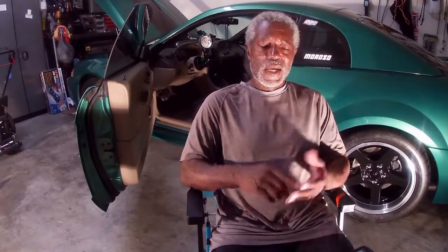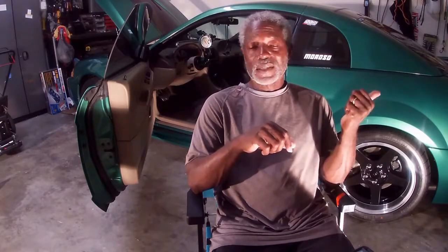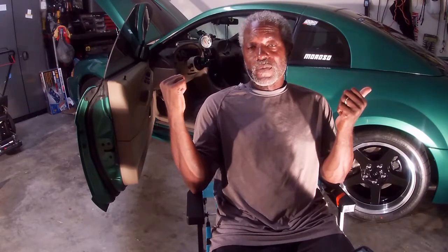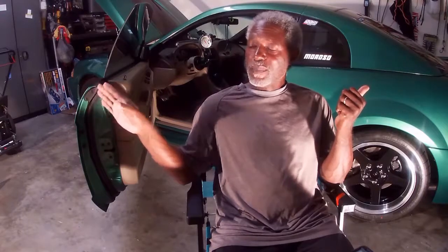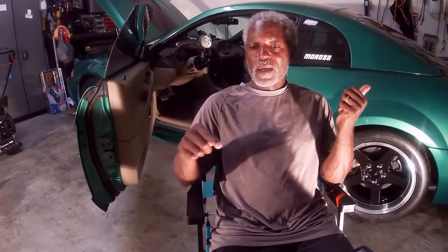And so you have to take loose the power steering hoses that are underneath there, anything that connects to the radiator. I had to take loose my positive battery cable because my battery is in the trunk, because I have a reservoir for my supercharger, which coolant goes in to keep the supercharger cool. So that is in the place of the battery compartment in the front. So I had to loosen that wire because that wire was wrapped around and twist tied to my K-member. So I had to drop that out of the way.